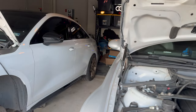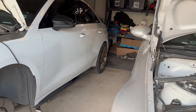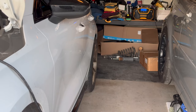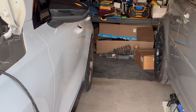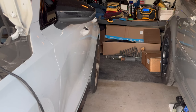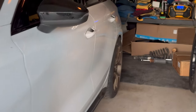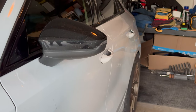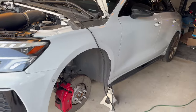Sorry I didn't get another clip of the backs before I put the wheels on. As you can see, I might've added a little too much camber — it looks like it's slightly positive now. So I'm going to do a half a turn in. And I forgot to adjust toe — I thought about it and was like, eh, I have to see it with the car on the ground. So we'll have to deal with that later. Now we're moving onto the front.